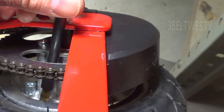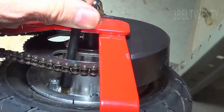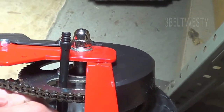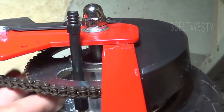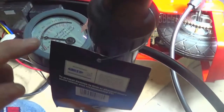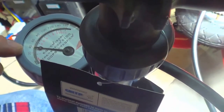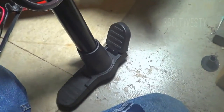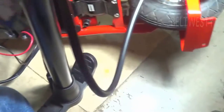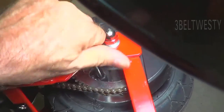Then I'm gonna go in with the hand pump and pump this up — screw this thing on here and pump it up. I've got this down to where it depresses the Schrader valve, lined up and square. I've got it hooked up. With the hand pump it's reading about 36–38 psi; when I let this go it's supposed to be about 36, and I've got about 38 on there. This is a little hand pump — Harbor Freight has these.